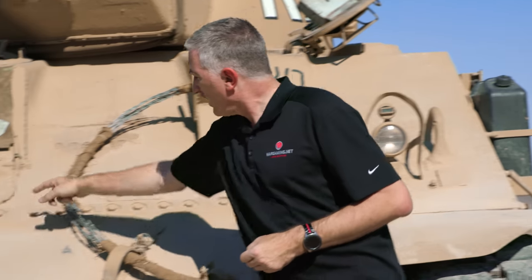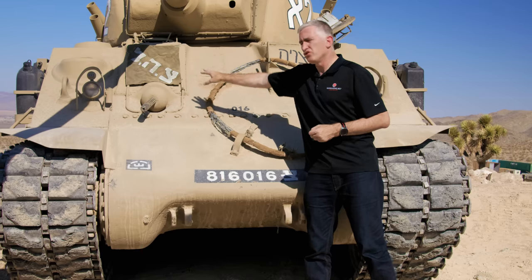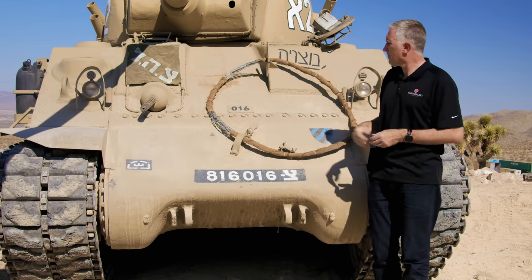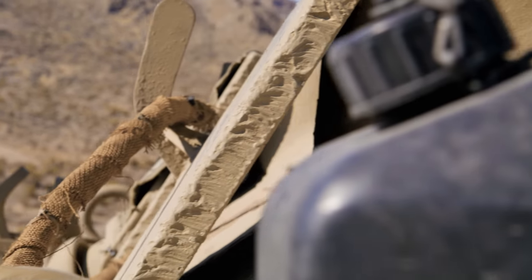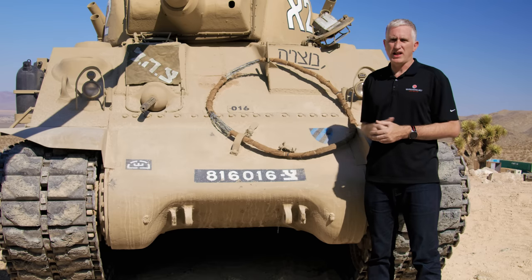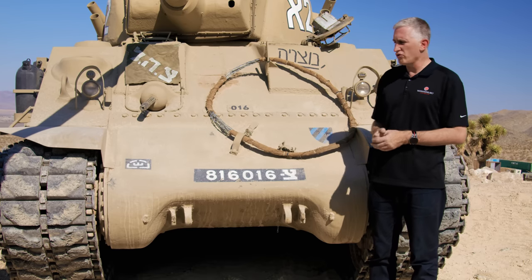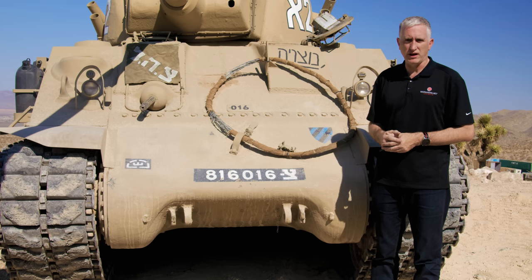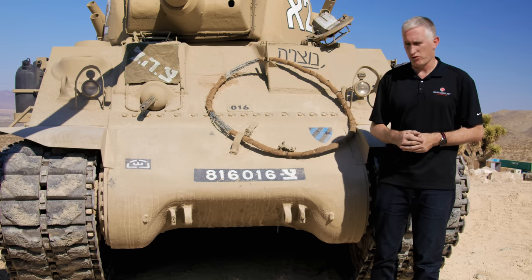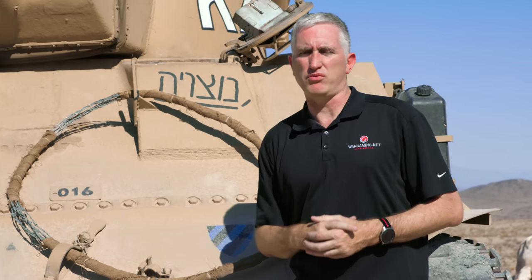The mounting point for the canvas dust shield does actually merge onto the new replacement plate. The armor plate itself is the old two inches, sloped at 58 degrees, and then we come down to the differential housing. As you can see, this is a late-production differential housing — the shark nose — but the vehicle itself was originally built with a three-piece differential housing, and I'll explain later how we know this. Another thing I'll explain later is this '016,' which further complicates this vehicle's history.